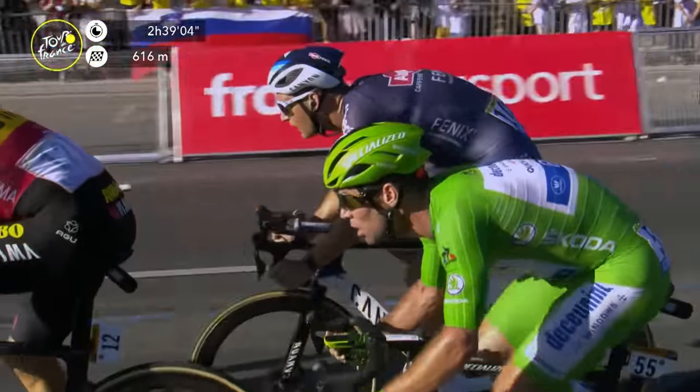So in the case of bike frames, designers will make use of the fact that carbon fiber can be flexible in certain directions. They will engineer what's almost like mechanical suspension, compliance within a bike frame, so you've got a bit that's designed to flex under load, to dampen it. Is that an area that's likely to then cause strain and failure?